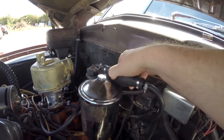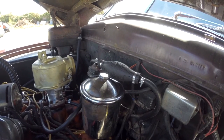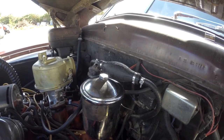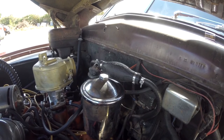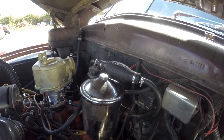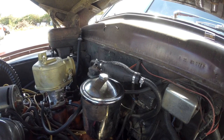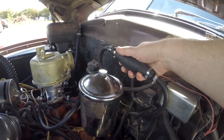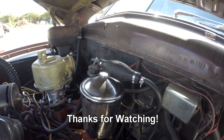So far it's in a pretty good spot — this area stays a little bit cool — but I just don't want it falling way down. Anyway, that's the low-tech solution for now. I'm sure someone will tell me this is completely insane, but it's simple and it's effective. I'm going to run this until I figure out a longer-term strategy. For now I'll start it once a week whether it needs it or not, and as long as the fuel bowl is full there's no problem starting the Merc. This is definitely preferable to dumping gas down the carburetor. So this is the little squeeze-bulb solution — that's that for today, thanks for watching.